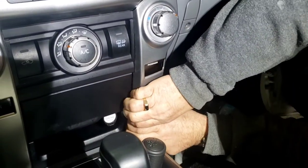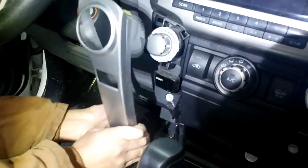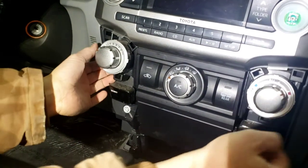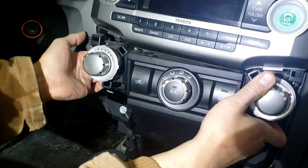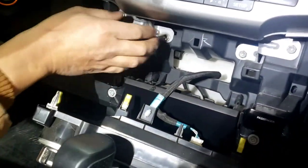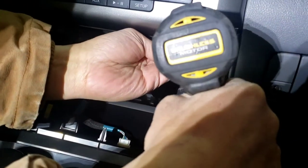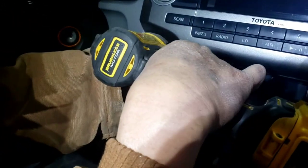He's gonna go easy on that and pull it straight out. While Ron is taking that side, I'm taking this side. Just pull it straight up, upward a little bit and out — just up maybe a quarter of an inch and then it should come out, then you can pull this piece out. It's a little bit tight, but pull it out like that with your hand or your flat head, just be careful. Once you get that out, go ahead with a 10 millimeter right there — one, two, three, and four — and it should come out.